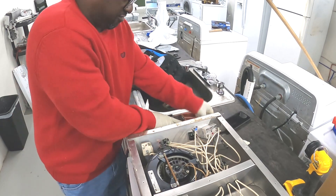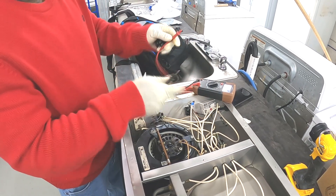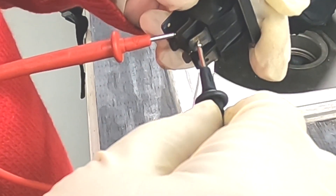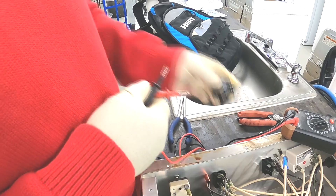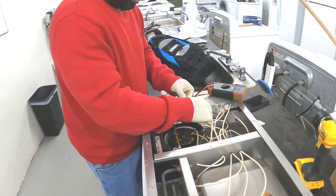The way I was able to tell if the switch was bad — you put your meter on continuity. You should get continuity. This right here is the common for this side. If I put the switch here and turn it on, I get a tone on this side, but on the other side I'm not getting a tone, so that tells me the switch is bad. If I come to the new switch and turn it on, I'm good. That was the problem — the switch was bad. Now I'm putting my wires back the way we had them.